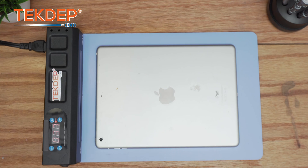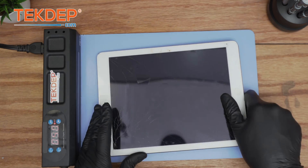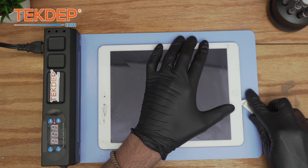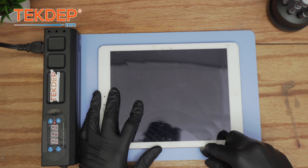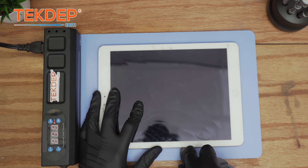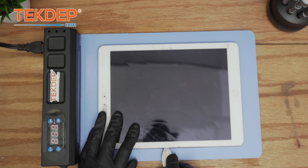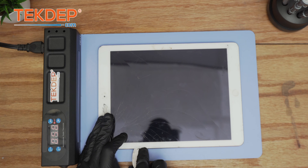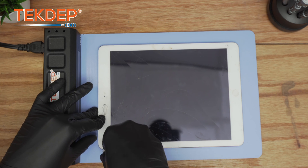Let it stand for about five to ten minutes. Once it's warm enough, flip it and start finding an entry point using the pry tool. I recommend leaving the mat on for a couple of minutes so you don't lose that momentum. When you come in close contact with the cracked glass, always make sure you go under deep enough so you can lift it — kind of like poking it step by step. Going from where the impact is, just poking and lifting.